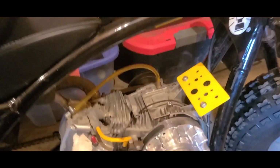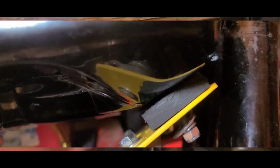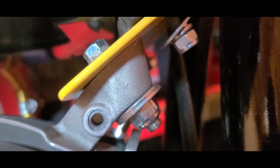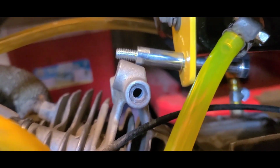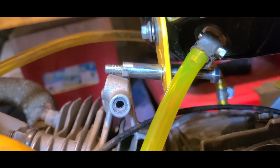Now I'm gonna lower it into position. While I'm lowering it, I'm gonna send that bolt through this hole. The studs come down and through in the front, and then added a washer, a lock washer, and a nylock nut to each one. I have to tighten those before we set the rear. As we tighten this down, it's going to suck in the bottom of the tank, and it's going to open up that gap between the anchor point on the block and the tab. When it does, the spacer is going to fall in place.